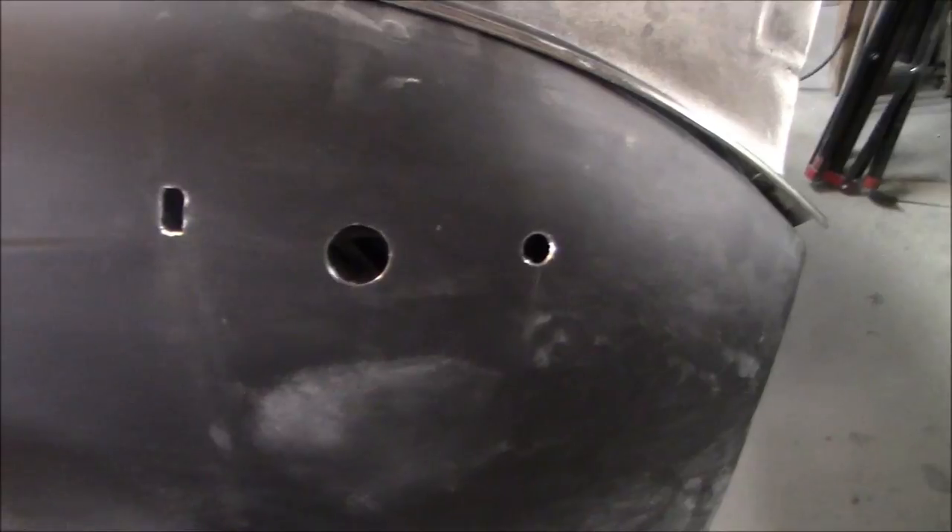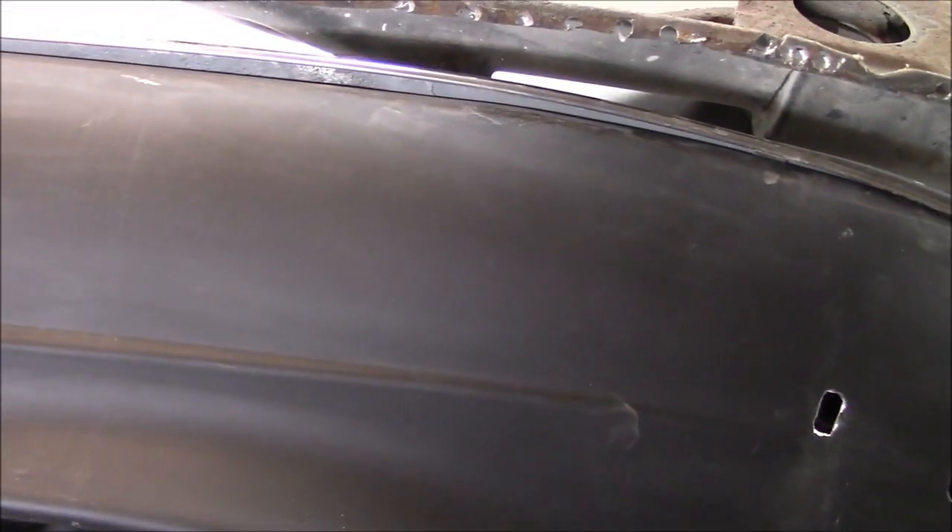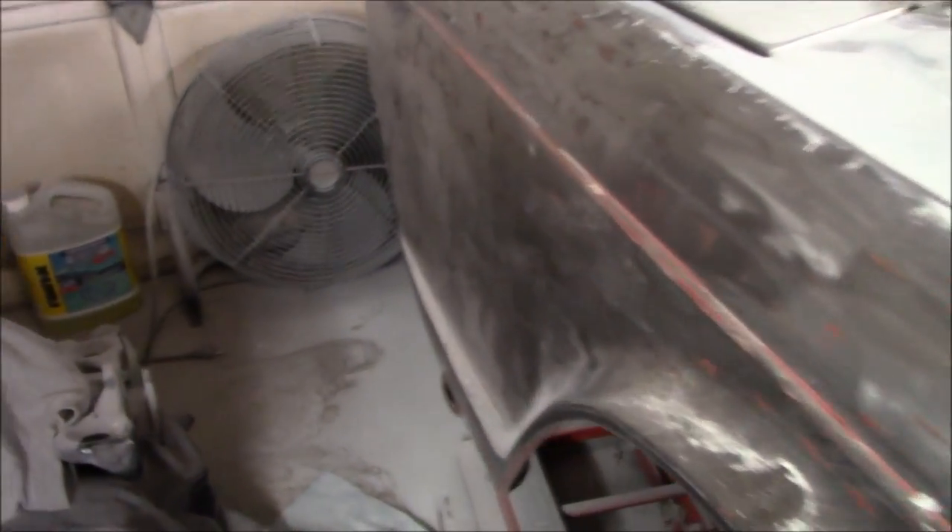Alright, I hope they're in the right spot — I measured a few times so hopefully they'll be okay. The spacing is about six and three-quarter inches apart, a half inch up from the body molding, all the way along, with seven holes for rivets. That's all done. Still need to do the locating areas for the rear wing marker lights, which were not on the TR4 fenders. The TR250s had a badge and a marker light back there that I need to drill for.